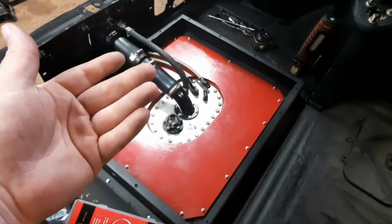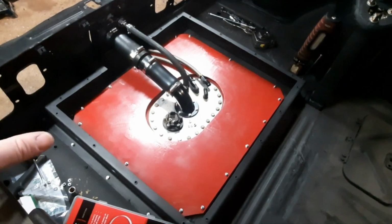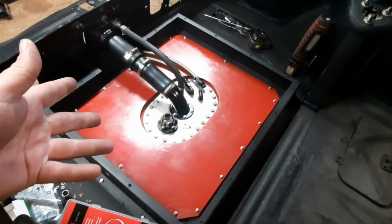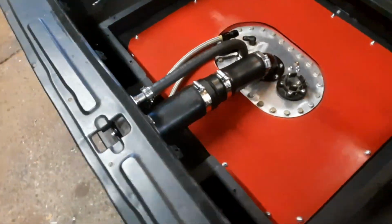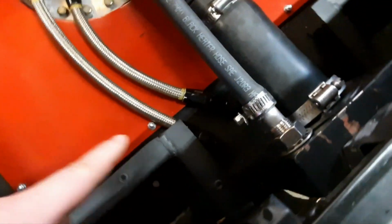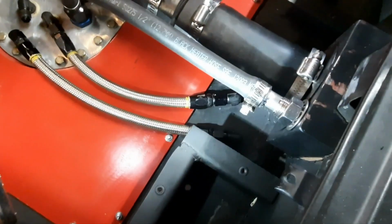Alright, well, this is the fuel system as it is supposed to be set up. The first issue that I've had with this thing, and I always knew it was going to be a potential problem, is actually right down here. I got terrible lighting. Those two bulkhead fittings. The reason that they are a problem is they sit relatively flush with the body of the car, which, when the fuel cell cage, which is the part that holds all of it together, was originally designed and I had just the fuel cell bladder sitting in that cage, that was perfectly fine. It sat flush, no problems, no issues.